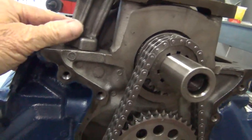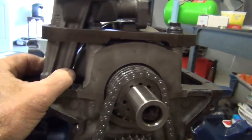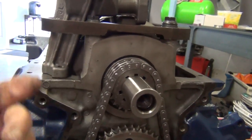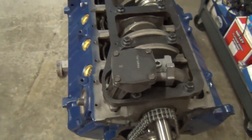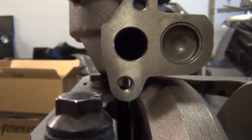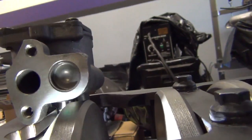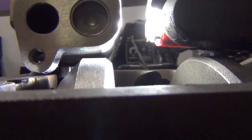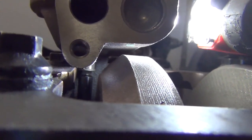I want to put the two bolts in here, snug them up, and then grab the drive shaft I dropped in there and make sure it goes up and down freely — it shouldn't move a lot but it should move freely, because we don't want that washer spinning and grinding into the block. I've got the oil pump kind of bolted down, just snug so it sits in place. You obviously want to make sure you don't have any clearance issues especially on a stroker crank — I've checked and we're all clear. Any moving parts, you want at least 60 thousandths between them, maybe 80.